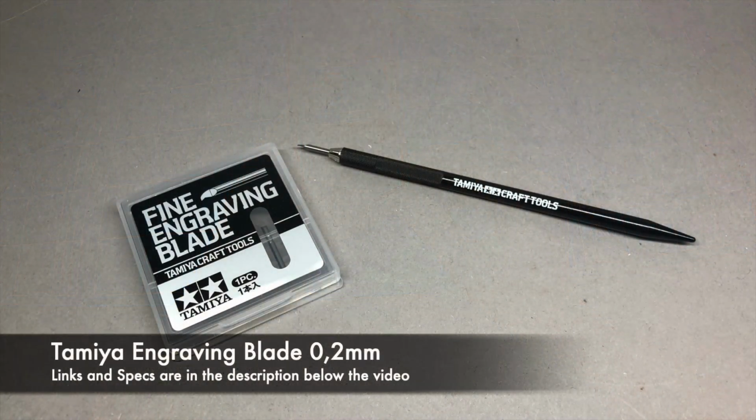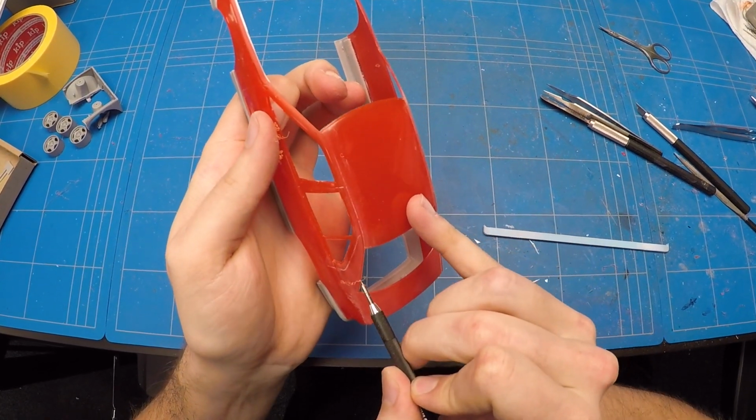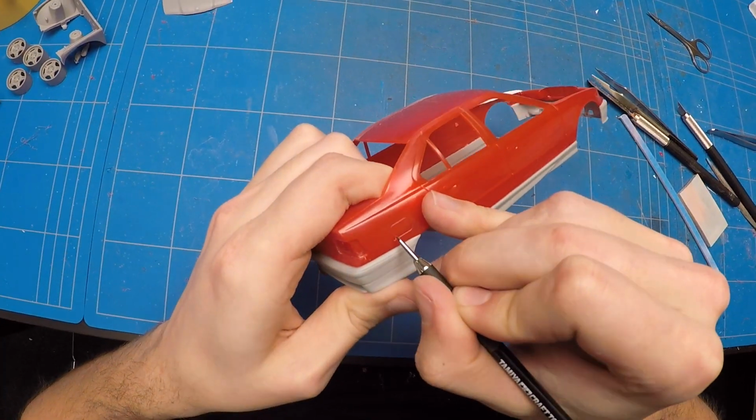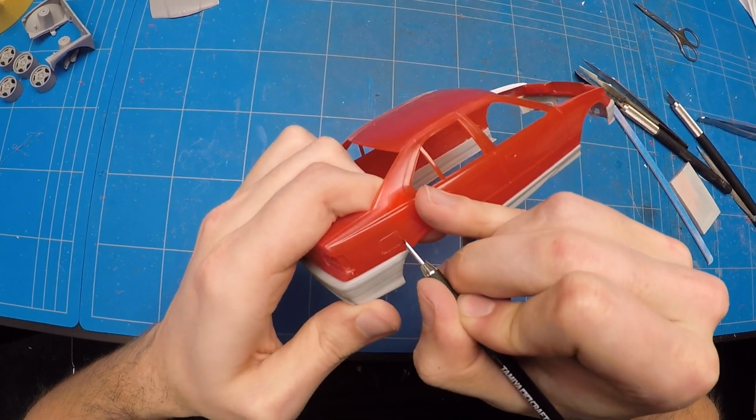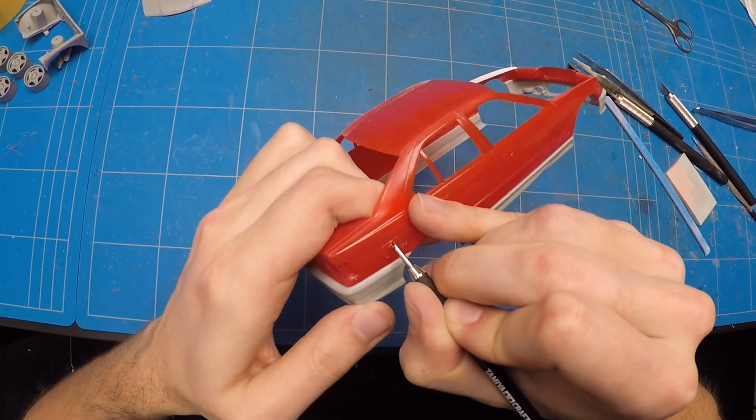All of the new body parts are now fitted. The hood is also fit and shaped correctly with that new piece on the side, and then all the panel lines could be scribed out to make them a bit deeper. Then I could move on to sanding the entire body down in order for the primer to stick to it and also remove some of the uneven spots.